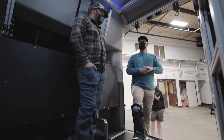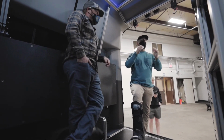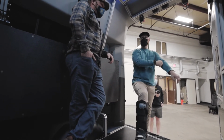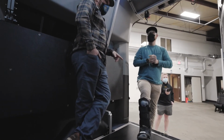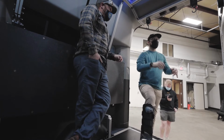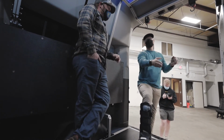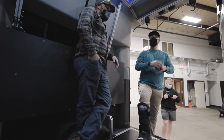That's pretty slick. I thought you could only do that with the lithium system. No, actually in our lithium, we are not able to send the power back this way. Okay. So with AGM, both being lead acid, we can run it back that way. That's awesome. Vehicle has nothing, we have power back here. We can connect it, jump start our vehicle, come back here, press it back to auto. It will never go back to auto unless you physically engage it. But that's super cool.